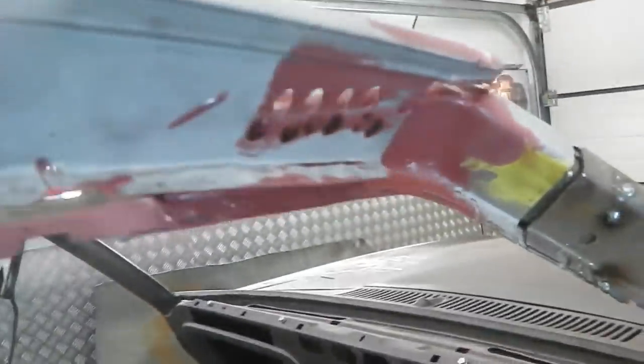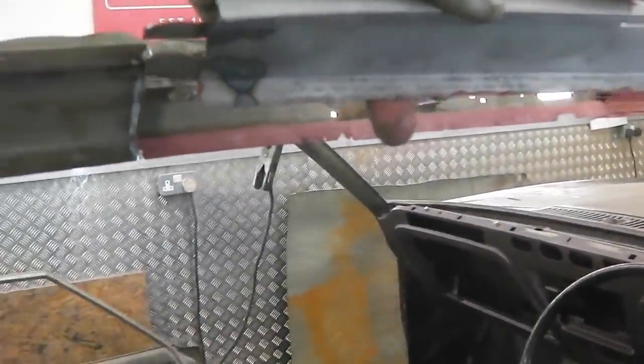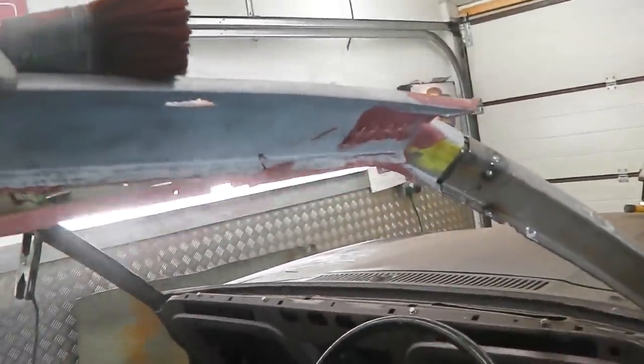Okay, weld through on. Our face is there. We're ready to offer that up. So we're going to clamp that in position now. That goes in like that. That's your gutter rail repaired. Almost done. Pretty happy with the way it's going, everybody. So can spot weld along that front edge, and then we'll have to plug weld up that top end when the car's on the spinner. Okay.